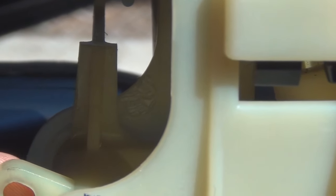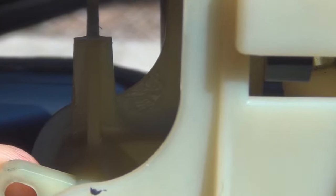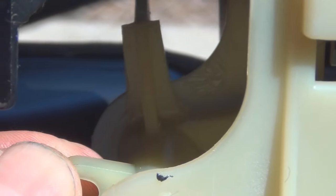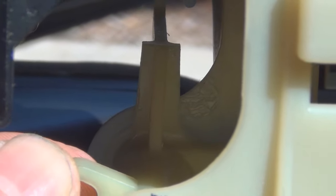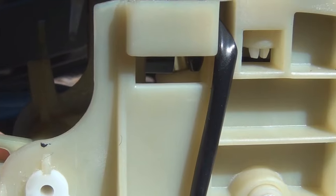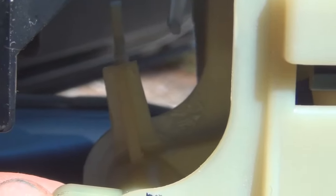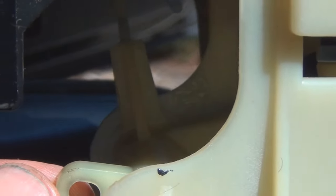After looking around a lot, I think the real noise is not from plastic on plastic. It's hard to get a good shot here, but it's just that the shaft and the pivot are not the right diameter. I can simulate the clicking sound by just wiggling the pivot against the barrel. I'm thinking the shaft isn't worn — it's the pivot that's worn inside there, because there's not much of a solid barrel. Just that slight ring there inside gets worn. That's why I think the first couple of years I owned the vehicle it didn't make a sound, but then that thin wall wore down.